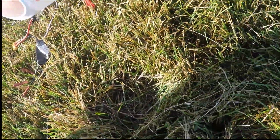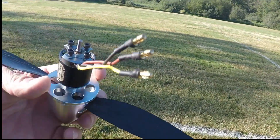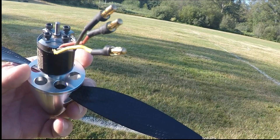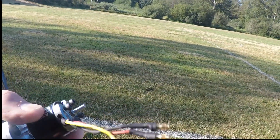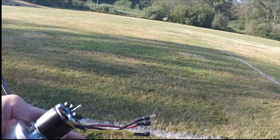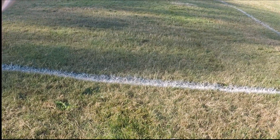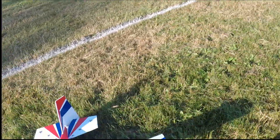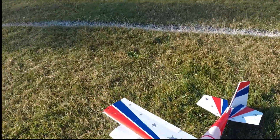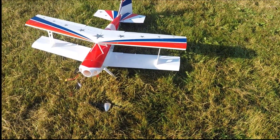I'm going to go with a 40-amp ESC and change the motor mount so I can get some washers in there, maybe go a little thicker — but the heat is what's killing it, this motor is really hot. I've got plenty of other planes to fly today. I'm going to call that an unsuccessful maiden, but I did learn.